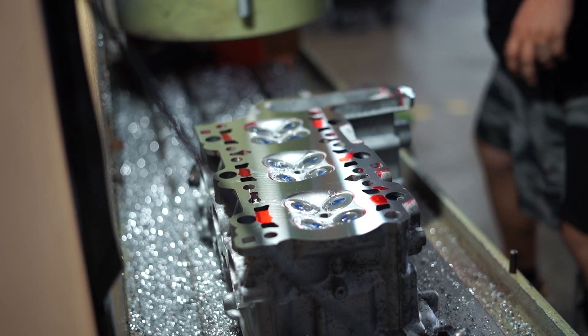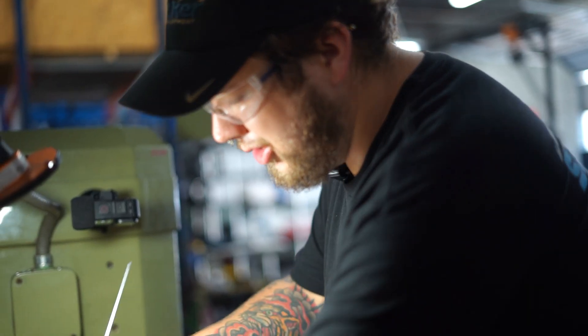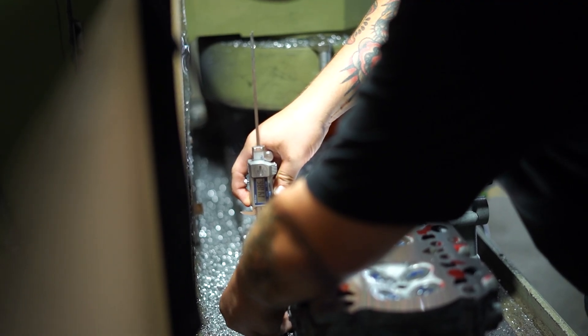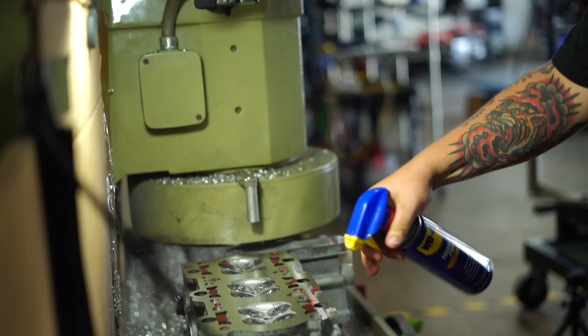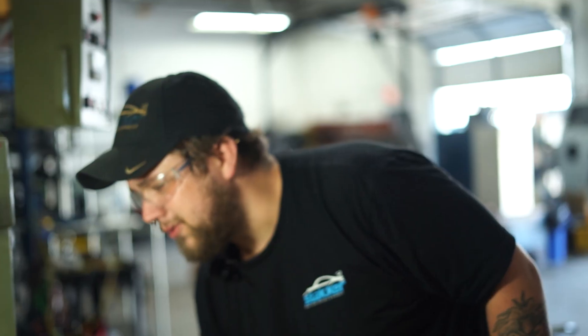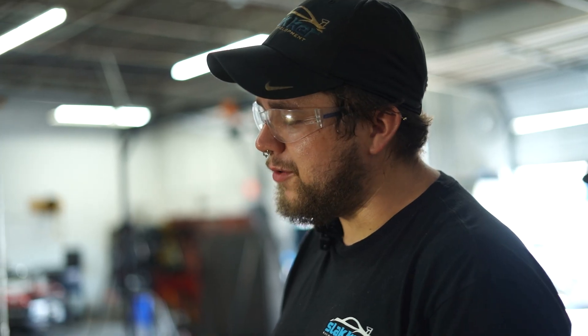We're going to stop real quick — I've already surfaced the other head and we just want to make sure we're going to wind up at a similar dimension. We still have a little bit to go. This is probably the dirtiest head I've had the pleasure to work on since I've been here. Typically two to three thou taken off — the highest I'd done before this one was about five thou, and it had some damage from shipping. But the other head, we took fifteen thou off of it just to get all of that corrosion to go away. That's the most I've ever taken off a head or case. Not great, but we're going to make it great.